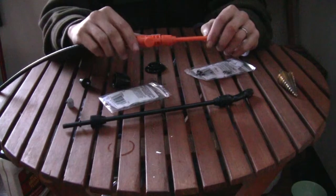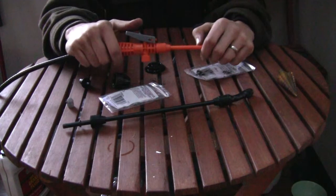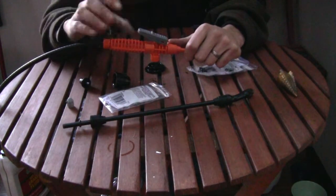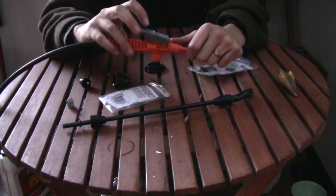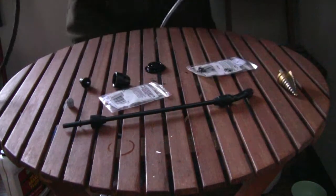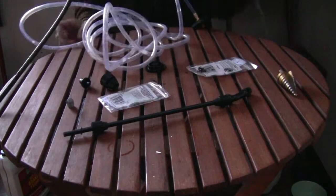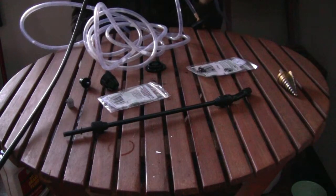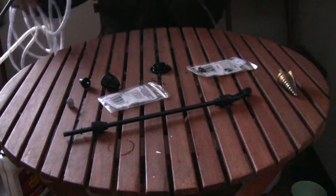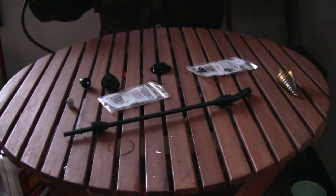This will allow you to regulate how much fluid is going through. If all your bleeders are closed, you don't need to put any fluid in. Open a bleeder and you can start letting fluid in. The fact that it's a long clear hose means you can carry this thing with you and put in a little extra pressure if you need to while you're working.